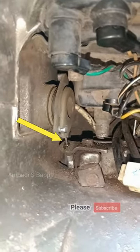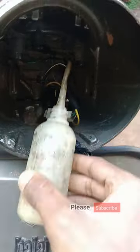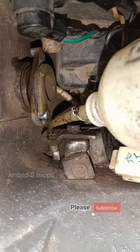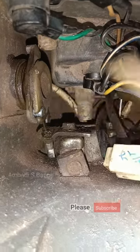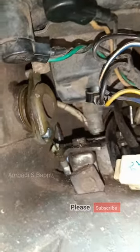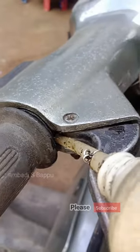The problem is due to these parts becoming dry from lack of lubrication. So apply some oil to the part where the throttle grip connects, and also apply some oil to the inner of the throttle cable. Adding some grease to the part where the throttle cable and the throttle inner rub together is also better. Also apply oil at this place.